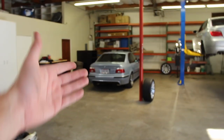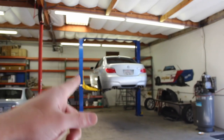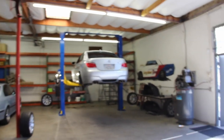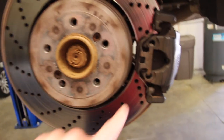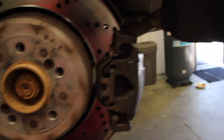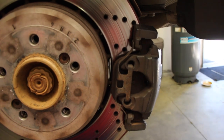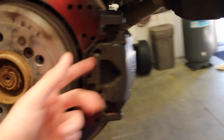They do squeak now on my car, which is a little bit annoying - I've greased them and they still squeak - but they work great. They never have on the E60, so we're going to roll the dice again and give these a shot. Real OEM states to replace the anti-rattle clips on the rear calipers. These right here - you just pry them out with a screwdriver. If they're over four or six years old, replace them. They're cheap, so why not? We got two of those. You only need two since the front calipers don't have them.